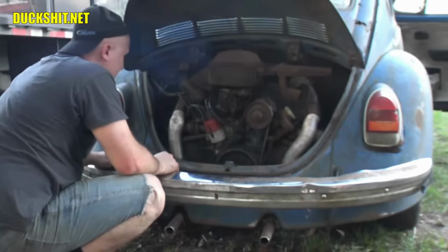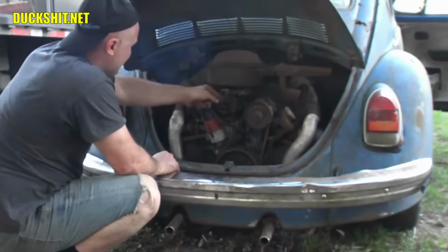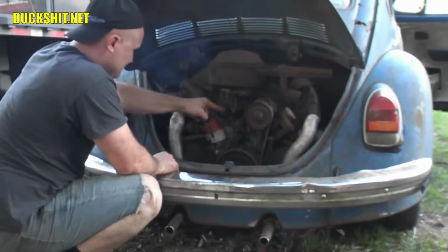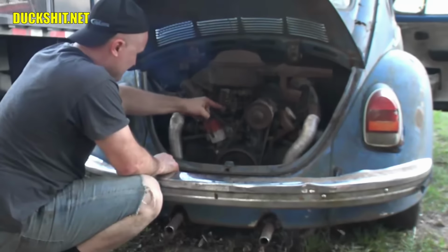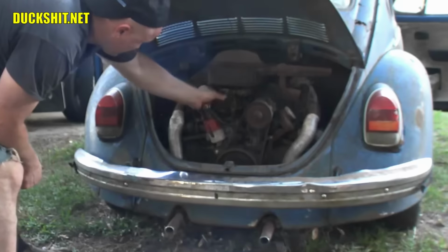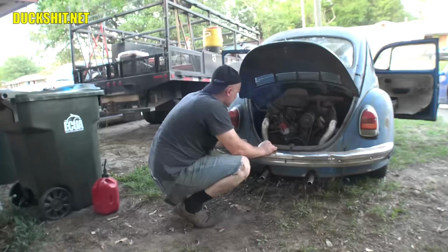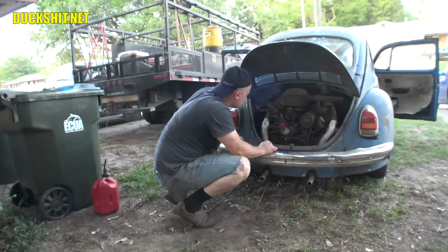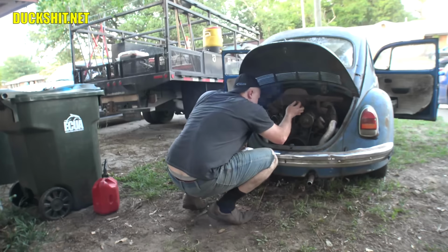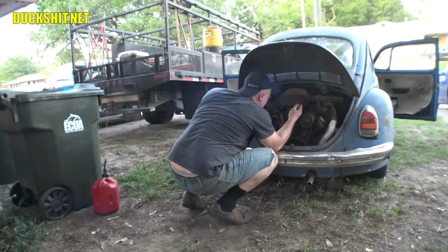It's a good sign. All right, is it off? Yep. Go ahead and turn it on and crank. It's on and cranking. Thank you. Yeah, it looks like it's out of gas. Turn off. Yep, turn off. He's off. Looks like it's out of gas. It's not getting fuel for some reason. Either the fuel pump isn't working right, or there's just not enough gas in the tank from what we put in there.